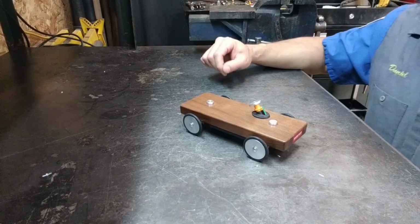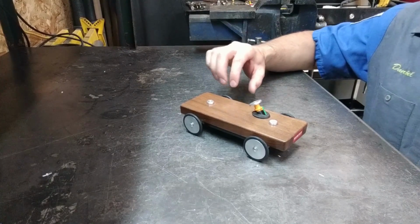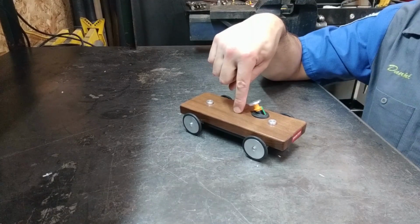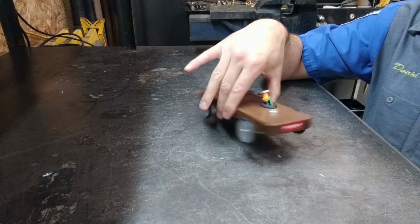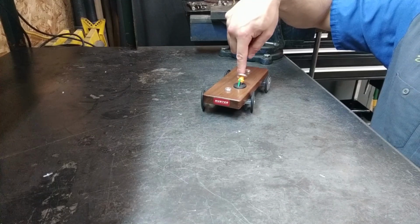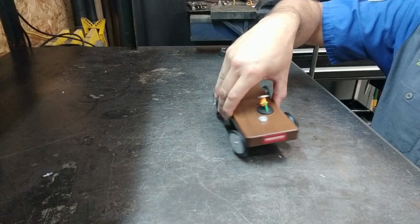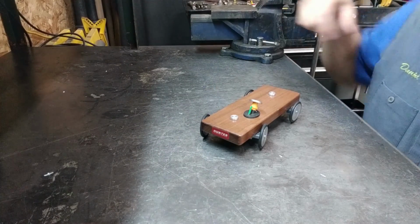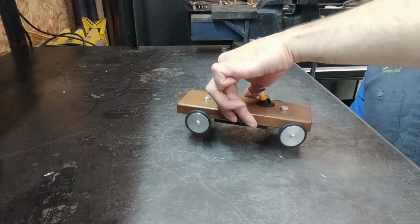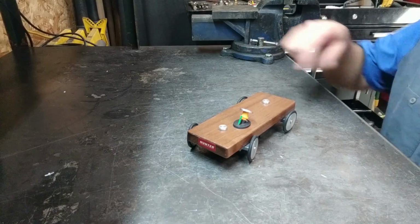In order for the control module to interpret the inputs, the sensors have to react to a few different situations. One of them is the vertical axis through the center of gravity of the vehicle, which would determine its pivoting point. When a vehicle is making a turn, there is a pivot around that center axis of the vehicle. If the vehicle is turning in one giant circle, the vehicle is doing this about the axis until it's going straight again.